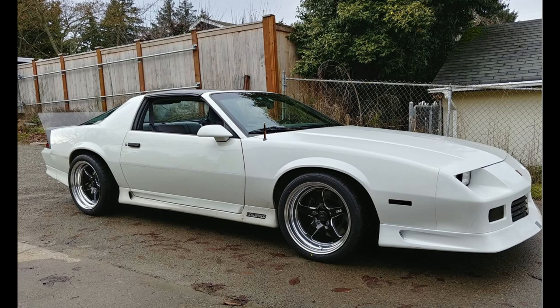In the next few months, I'll be rolling fenders and doing the math to fit 18 by 10 and a half inch rims on all four corners, with a goal to run 305/30/18 autocross tires on all four corners. See you on the track.